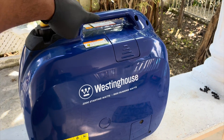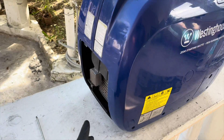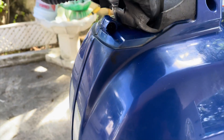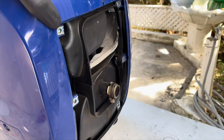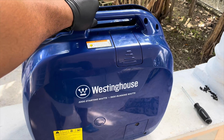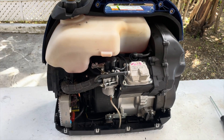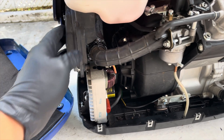Let's start by removing the side cover. We have a lot of screws to take out. You've got to take out the side grills — there's one screw hidden in here. Take out the other side grill as well, and there are about six screws in there. Just pull the side cover out. Once the cover is out, we'll have plenty of room to clean that carburetor.